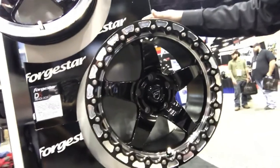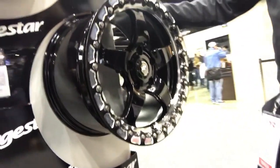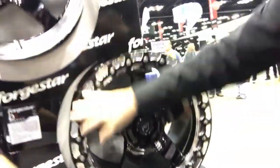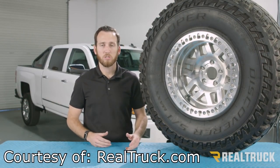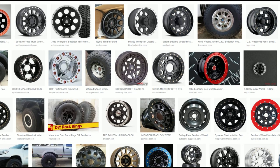Although leaks can happen between the clamps, it's easily prevented by installing them properly and regularly checking them. Second, they're great for hardcore off-roading or rock climbing because you can air your tires down as much as you want without being worried about the tire slipping off. Lastly, although opinion-based, beadlock wheels look cooler than regular wheels — and there's a reason why there are so many fake beadlock imitation wheels out there.